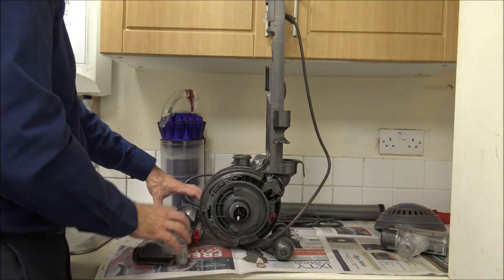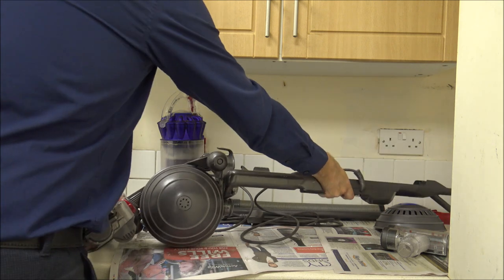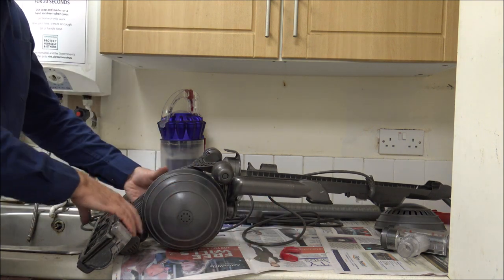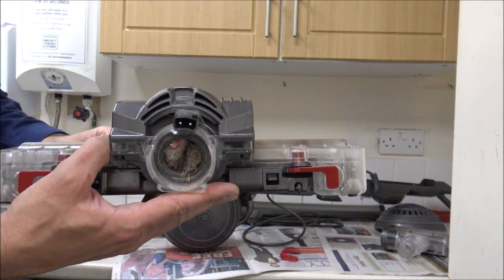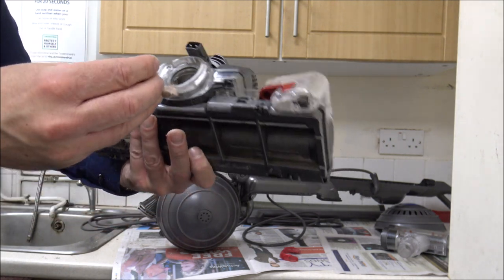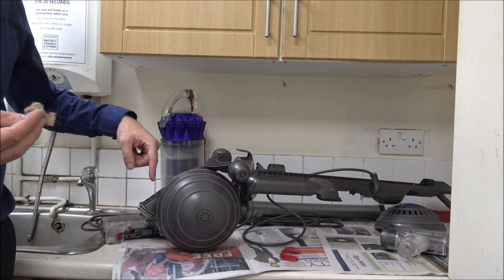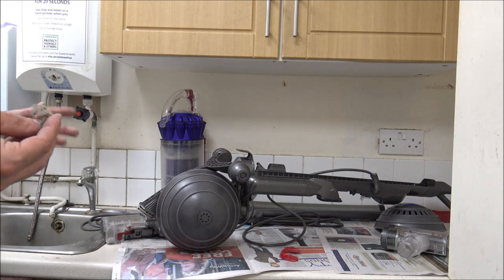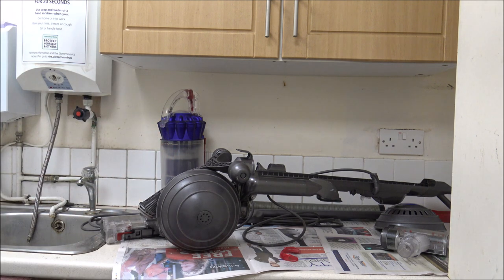What I want to do now is take this base plate off to get the main roller head out. I need to take this clip off at the bottom. If the customer had a loss of suction, then that could be a good indication why - you can see all of the dirt and dust coming out, so that's never a good sign. Clearly that's part of the U-bend at the bottom. That's one reason that Dyson put quite a few of these little pipes in that you can take out. If this has stopped sucking, then that could be part of the problem. Let's just get rid of that in the bin.